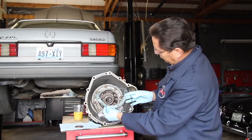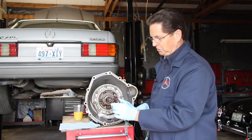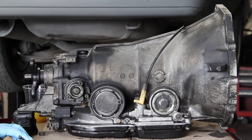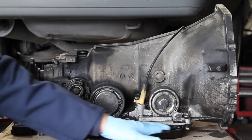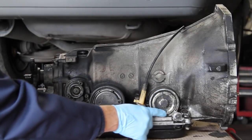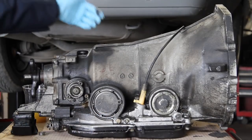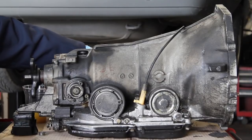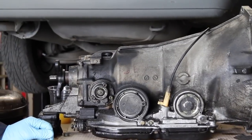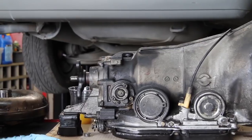The kit will also include a large paper gasket that you'll need for that housing. Any time I pull a transmission, I always replace the torque converter seal with a new one. There are some other places to check for leaks while the transmission is on the bench. We already talked about the pan gasket in a previous video, but these piston covers can also leak — they're sealed with O-rings and you'll see wetness right at the base if there's a problem. You can also experience a leak on the back side coming out of the shift shaft. You'll always want to take a look at the rear seal. I've found that rear seals don't leak as badly as the front — oftentimes I won't replace them because you can replace the rear seal with the transmission still in the car.